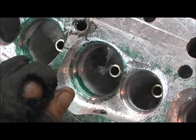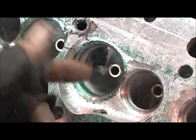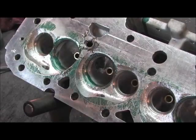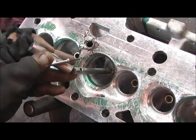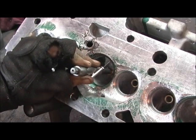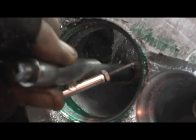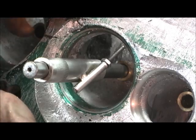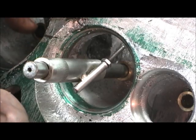From my other videos, when I went in there with my scribe tool and set the radius height of the seat — just to refresh your memory, I'm going to show you that again. This is just a typical pilot that you do the valve job with. And this right here is my threaded cutter. I actually made this tool myself a long time ago. What it does, after the valve job has been completed, it goes in there and lays up against the seat and scribes a line that is to be determined by me — whatever mathematical diameter or how far the radius is up or down.